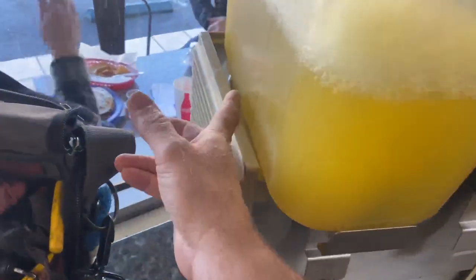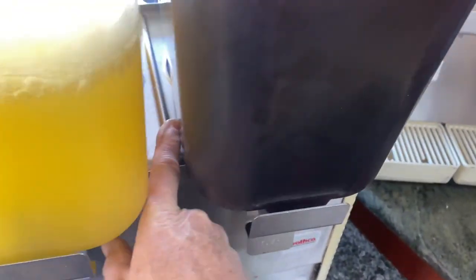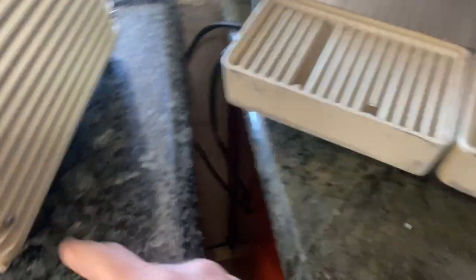The magnets are good — there are magnets under here that spin, the motors spin the magnets, pump the fluid. The plate up here gets cold — that's the refrigeration plate. There's a condenser in here, a cap tube system, a couple switches, and a thermostat for this unit. Let's open it up.